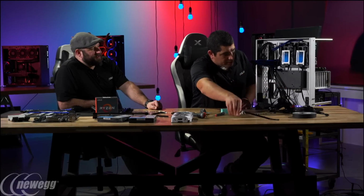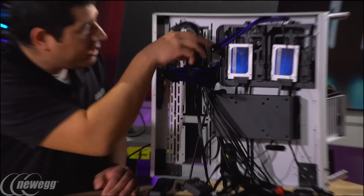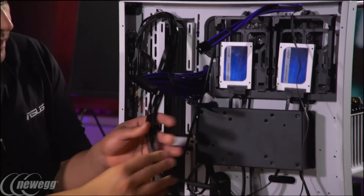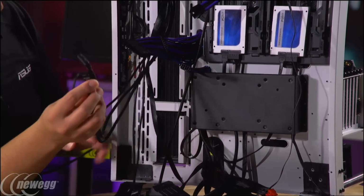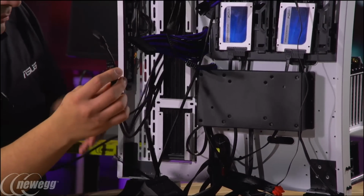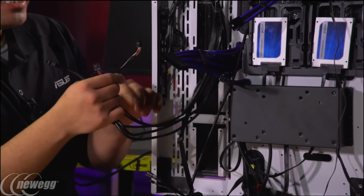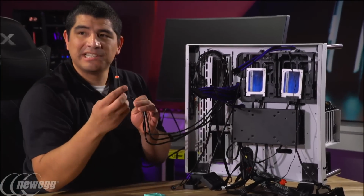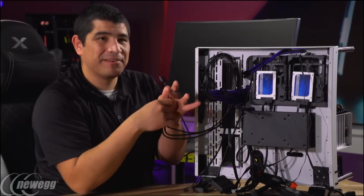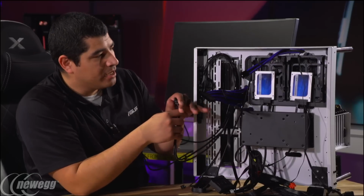So you can see right here, we've got our key cables, and we've got a couple of other little I/O cables that I'll run through right now. I think the main ones are front USB 3 and HD audio. I won't worry right now about connecting my front leads. I'll just jump them with my screwdriver. You guys might be interested to see how that turns out if you've never jumped a board with a screwdriver, but that's what I'm going to do.